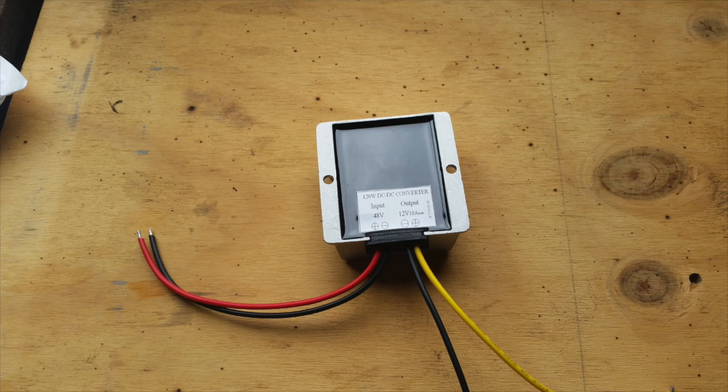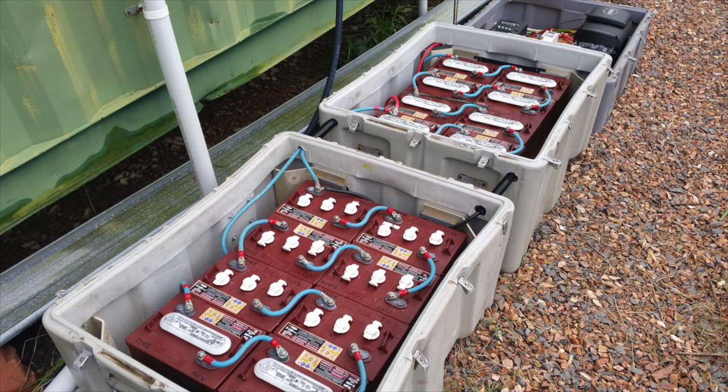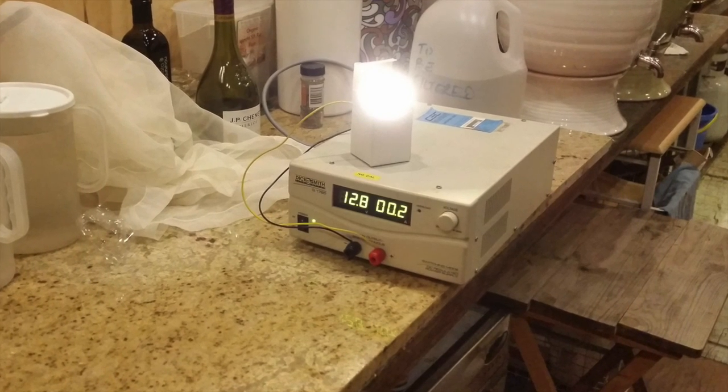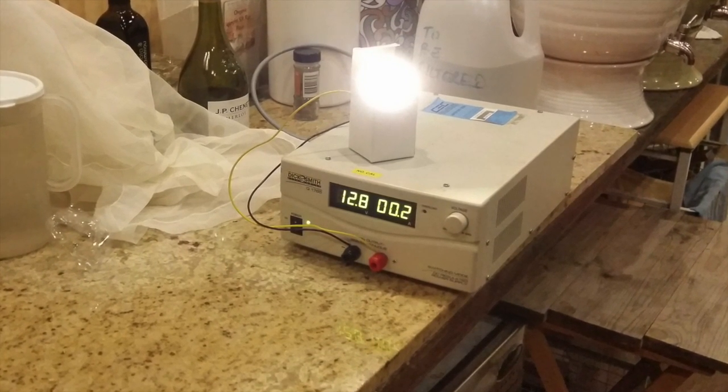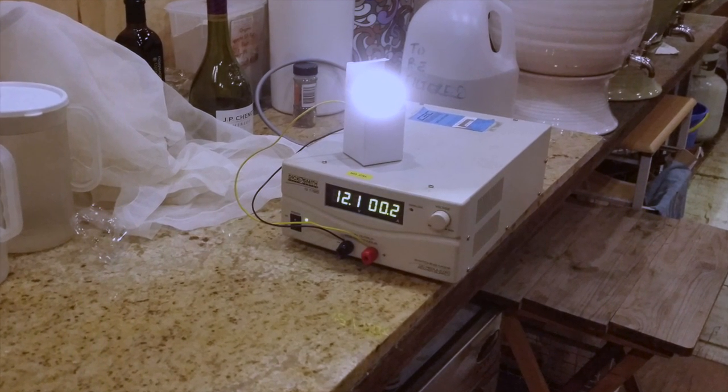Unfortunately, after I installed it I had all sorts of problems with my lights. All the lights went to a much dimmer setting, and when I put on multiple banks of lights some would dim and go off. The lighting is all misbehaving now. I've also noticed that my batteries are being drawn down much deeper than they used to, and I don't like that. I've got used to seeing my lights working at 12.8V in normal condition, but when you drop it to 12V — its correct working voltage — there's a lot less light.